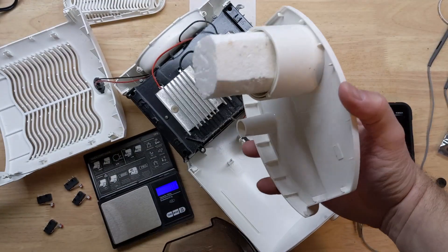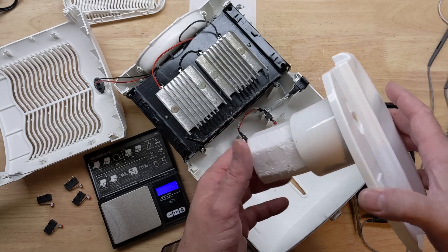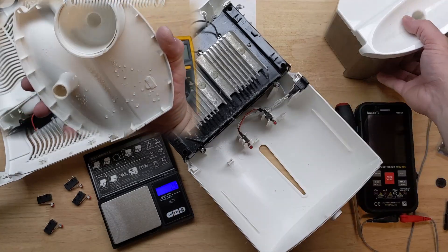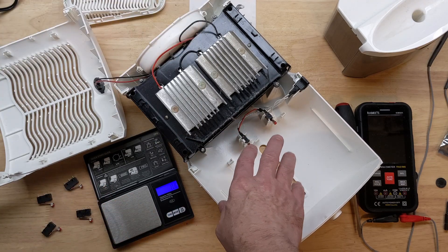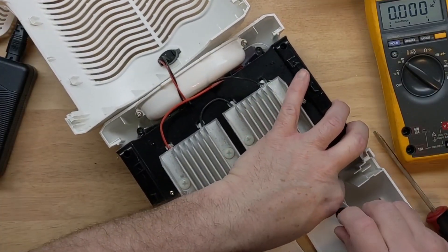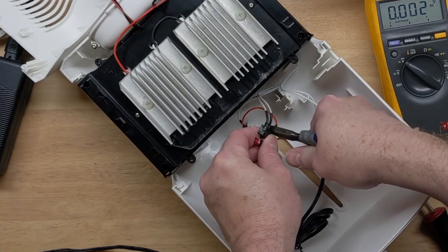The heavier actuation force matters most on the float switch. I'll show you what I had to do the last time — I actually had to extend the float. I know it looks ugly, but I had to calibrate and shave it. I tried to show footage from my first repair, which I videoed over a year ago but never posted. Originally it's just an air pocket that pushes up, and at the factory they probably calibrate or select switches at a certain gram rating. With one of mine at 80 grams to activate, I had to add float displacement to help activate the switch, then shave it down to calibrate to the full level.